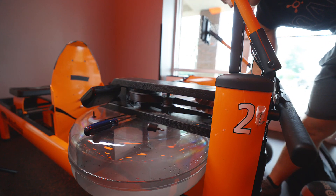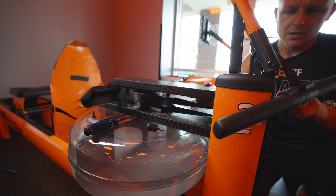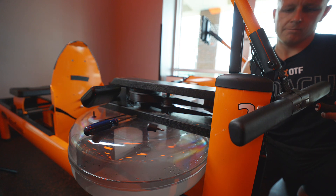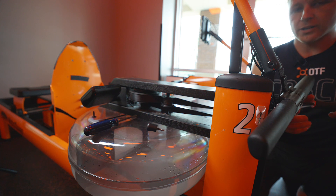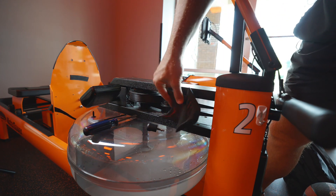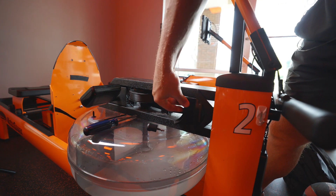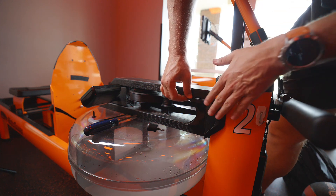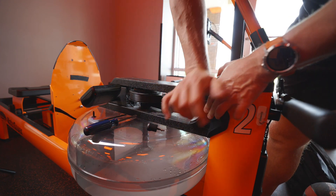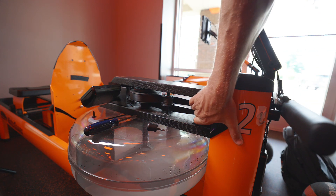Do the other side — line facing down, get the screw to run all the way through, find the hole on the other side, and we're locked in and loaded. I don't tighten these all the way down — keep them loose just a tad. Now it's time to put in the plastic pieces again. This plastic piece is going to sit inside this lip, with the little WaterRower logo on the outside. Lift from the bottom, push that in, then push down on the top — and you'll hear it click. Pull it forward — clicked, that one's in position.